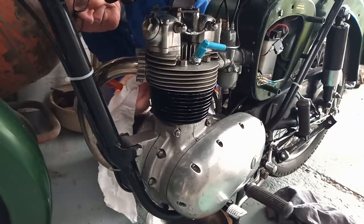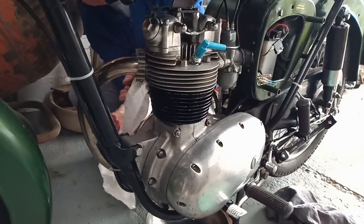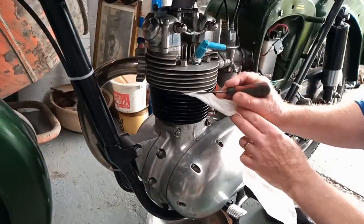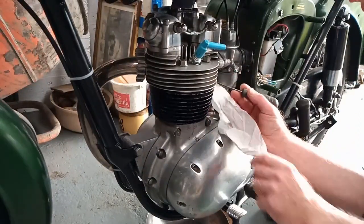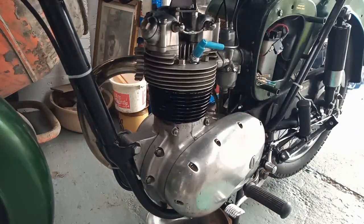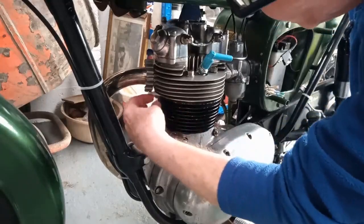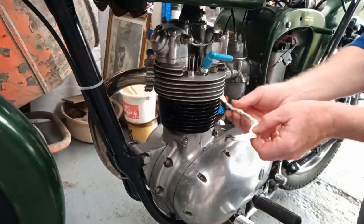I also had an oil leak from the cylinder head, and this showed oil gathering round the bottom of the barrel. This is me using toilet roll to try and show where the oil leak is coming from, and most of it seems to be from around the top of the pushrod tube. As I'm taking the loo roll away you can see the oil gathered from near the pushrod tube area.